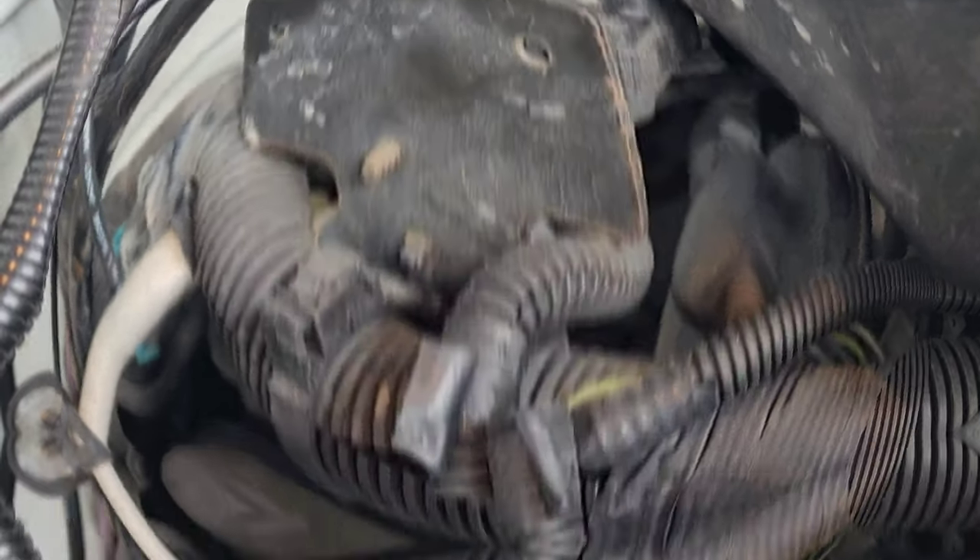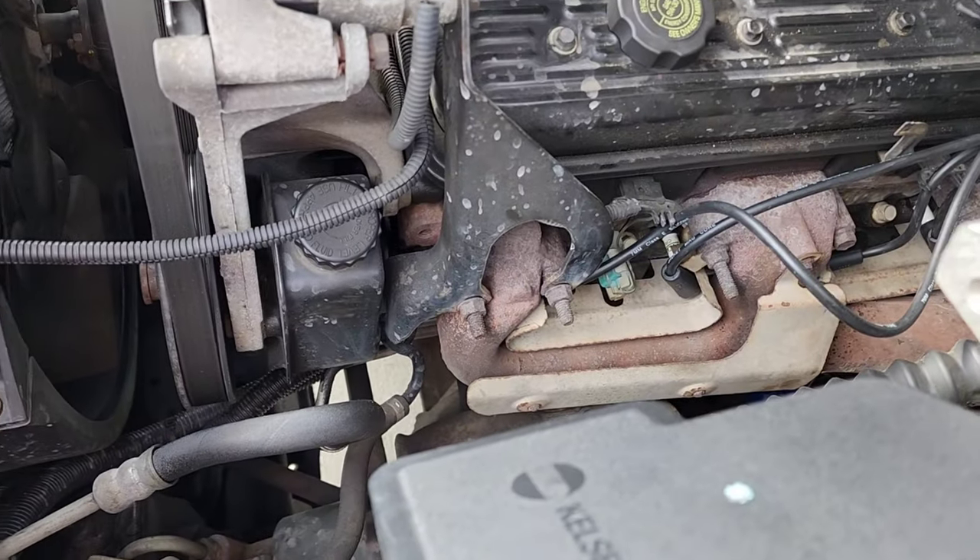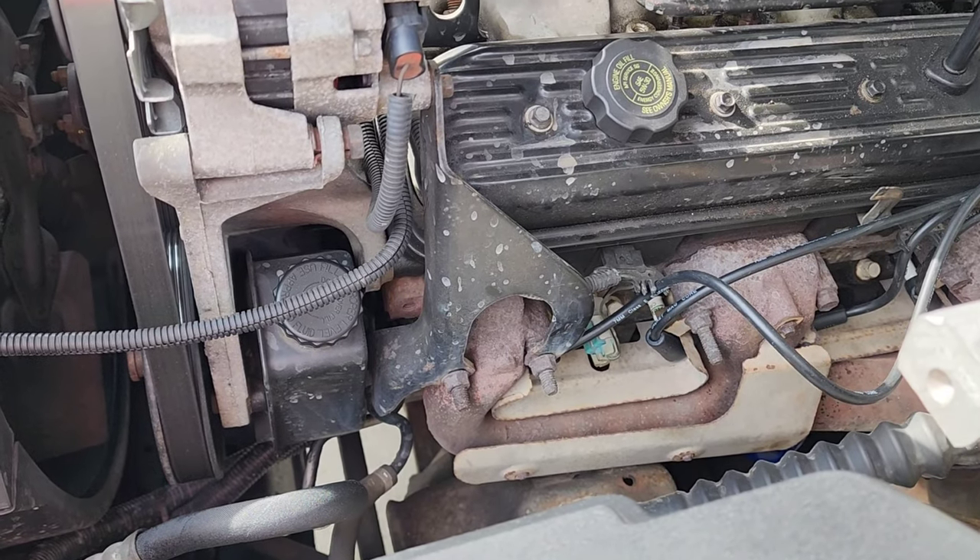However, the distributor is not in correctly and it is not timed properly. So basically, here's what happened — I was following a video by a manufacturer of car parts who also has a very large YouTube channel, and don't get me wrong they do great videos and great tutorials. Here is the one thing that I did wrong: I followed a video where they replaced a distributor and the vehicle was already in time. So when I took that distributor out, what I did not do was come down to cylinder number one and put it at top dead center. By not putting it at top dead center before I started this, what it ended up doing was putting the rotor out of whack and it was out of alignment when I took it out.